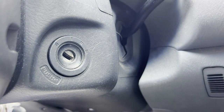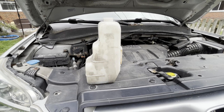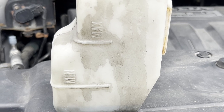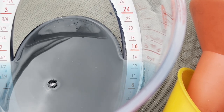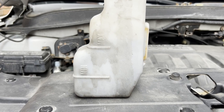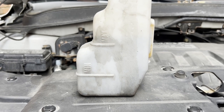Close the cap all the way. The coolant bottle has a minimum and maximum line marked on it — we're going to fill it up to the max, then add 14 additional ounces to account for coolant volume shrinkage when the coolant cools. This is how full your bottle should be. Now that the coolant has cooled down, you can see we're still above the max by a little bit, so pour off that extra and get back down to the max.